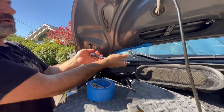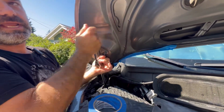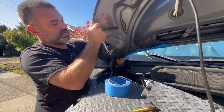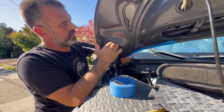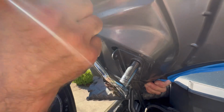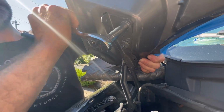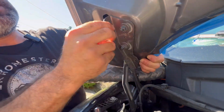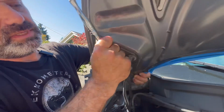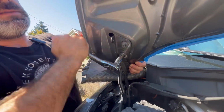So we've got our ratchet, 13 millimeter again. You can use box or open-end wrench. I would not use an impact driver, as tempted as I am to do that, because that could get away from you, especially if you're going to tighten it back up. Now, one of the things that you're going to hear is a little bit of crackling sound. Don't be alarmed by that. All that is a separation between these two. There's some dirt, debris, just things that have kind of secured themselves throughout Bad Betty's travels. And again, as you can see, why it was so important to scribe this, we're at the point where this is starting to loosen itself up and can potentially become out of adjustment. It would be a little unlikely, but to prevent that, we used the pencil and we scribed.